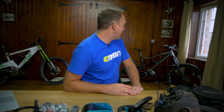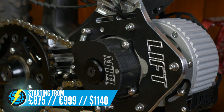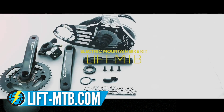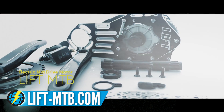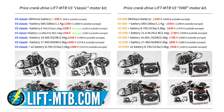This is the French-made Lift MTB — these start at about 999 euros. When it comes to power output, remember this is a throttle-only unit: 450 watts nominal to 750 watts max, with 80 to 90 newton metres at the rear wheel. It's a pretty light system at 3.2 kilograms. The Lift MTB has a vast range of batteries, ranging from about 1.1 kilos up to 2.9 kilos.